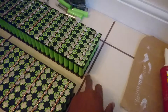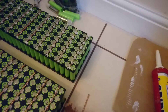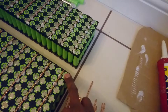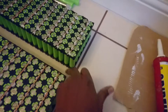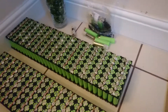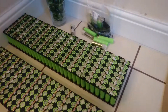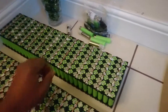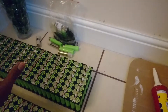Here, because this is positive, here it will be negative. So negative is going to connect to positive on this one. Here is positive, here is negative. At the bottom, here is negative, here is positive — so they're going to connect together. Then on the other end we'll have positive, and then we'll have negative, which will be connected in parallel with the battery in the car. I want to make this very, very simple — I don't want to complicate it with computers and all that. I just want it to connect in parallel, full stop.